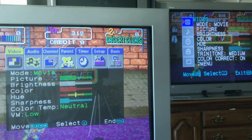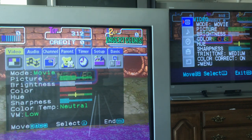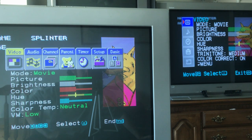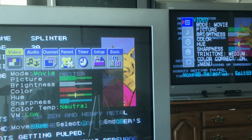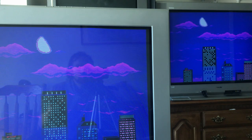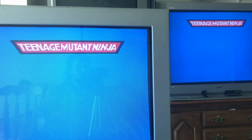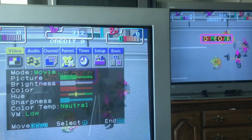The year doesn't seem to matter either — the set on the right is a 1999 and the set on the left is a 2000. On the right-hand menu, toward the bottom you can adjust Trinitone and Color Correct. Color Correct will dim the reds, and Trinitone will affect the colors — there's an NTSC setting which is more green, and if you set Trinitone to high it's more blue. I tend to leave it on medium. So if your CRT is getting old or the white balance is off, you can use that setting to dial it in.